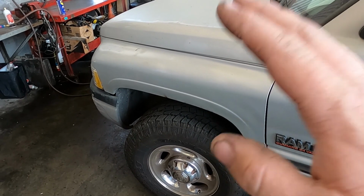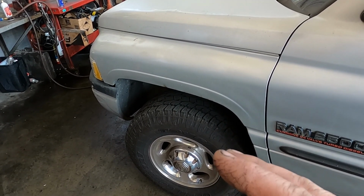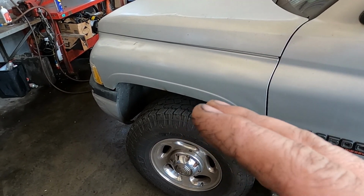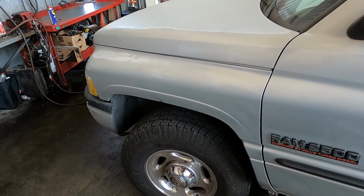All right, so I got the brakes all bled, wheels are torqued. Now I need to go out and drive the vehicle and bed in the new pads and rotors, and then double check to make sure the hydraulic system's functioning. The vehicle does stop and it's all fine and dandy for the moment. So what I'm going to do is ship the vehicle and return it back to the customer.